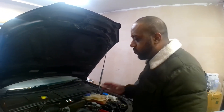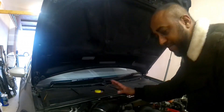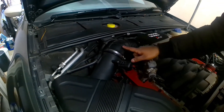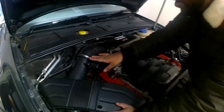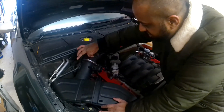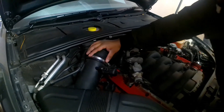I'm just going to show you where you inject that nozzle. It depends on what car it is — I'm just using my air intake as an example. In the ideal world, you want to inject it after the airflow meter. Although it's going to give you a bit of a funny reading, it's not really going to do any damage. You want to undo this, inject the hydrogen gas into the intake, and then close it up so it's nice and airtight.